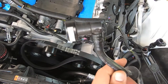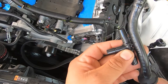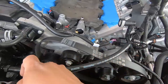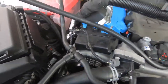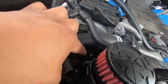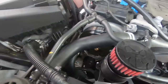The can comes off like that. I'm gonna cut it somewhere down here right in the middle, put the tee in here, and run the line to the can. So I teed off on this line — I found a piece of hose and I'm gonna let this hose just chill right there for now until I put the supercharger back on, that way I can make sure I have enough to run into that fitting back there. If I do, I'll just tighten this bolt and it's pretty much done.